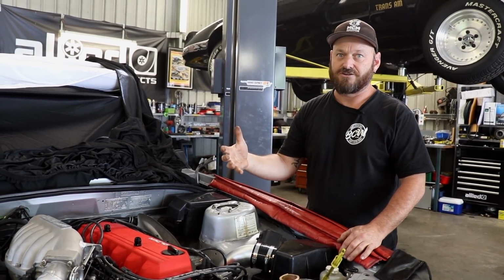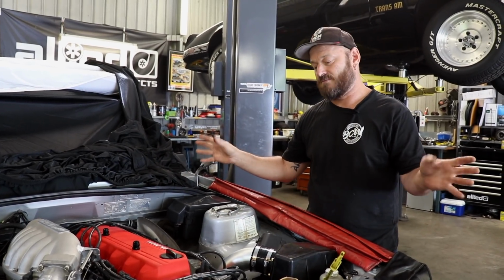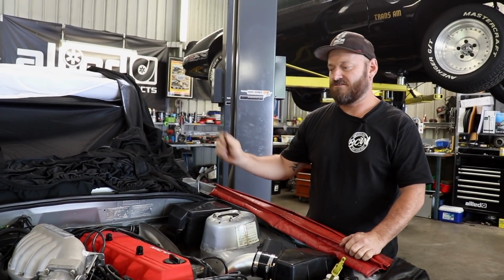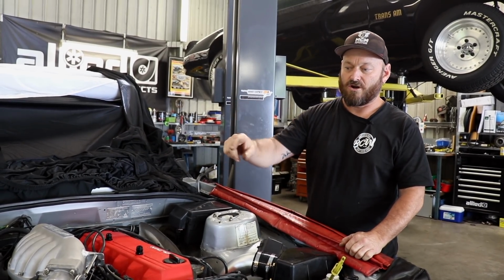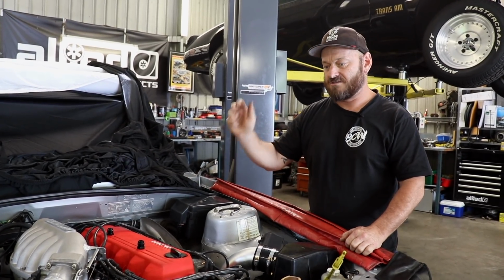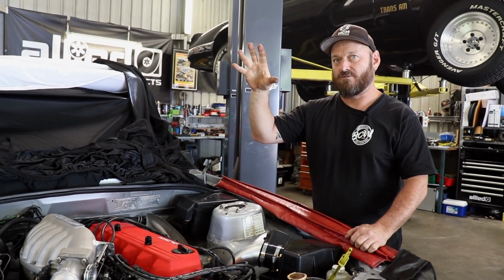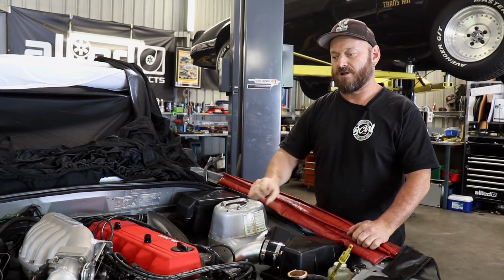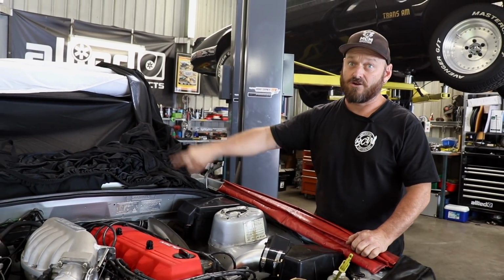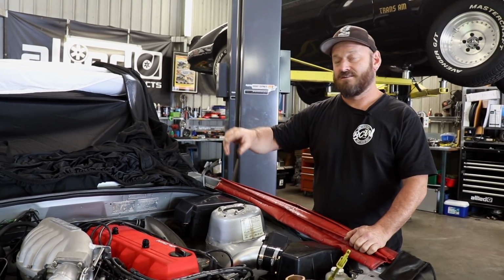Then you've got to start your engine. Obviously it's going to be a bit difficult in this case because the engine's not going to run perfectly first up. Well, maybe it will, but don't expect it to. If you're just doing a change, start the engine up. What I normally do, if you've got a cable throttle, is just quick revs. It's speeding up the water flow from the pump, dropping it off. That helps to push coolant through the heater core because the heater core is always the primary bypass.